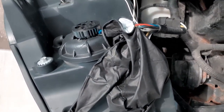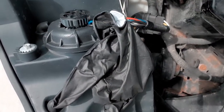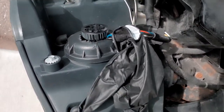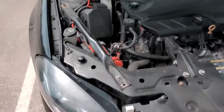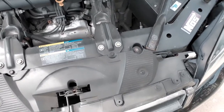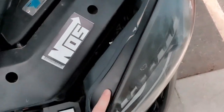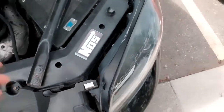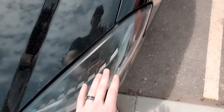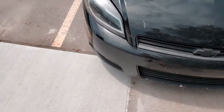The fog light cord connects to the same part of the wiring harness as the lights. LED H11 should be fine — I didn't need to do anything weird, it just goes right in. The only hard part is the main headlight dust cover modification. I just punched a hole through it, ran the wires out, plugged everything in, and covered the important bits with rubber and zip ties. I might get a dust cover cap. Super bright at night — really happy with it, and no issues with water exposure.